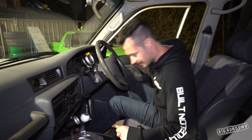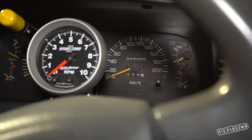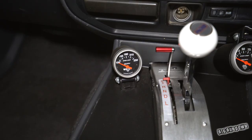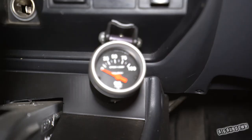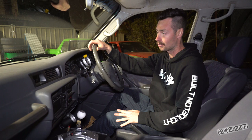Inside — this is maybe the second or third cruiser I've been in — this one's a bit different. Pretty standard dash; the outside and inside hasn't really been touched, but it is quite nice. You've got smack bang in the middle your rev counter — very important. Don't worry about speed, you want to know what revs you're at. The shifter is obviously a two-speed powerglide, so there's a mechanical shifter in there, a B&M Quicksilver it looks like. You've got a water temp gauge, that's important, and your oil pressure, also important. Other than that there's not a lot else — very simple. You pretty much just throttle, brake, drive it hard and that's it.